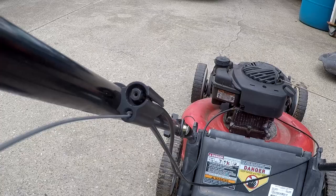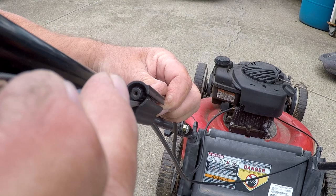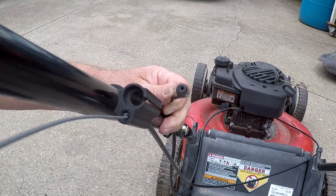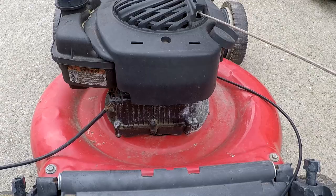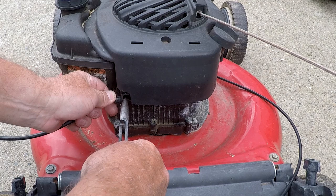Go ahead and remove it from the bar right here. Come in here with a screwdriver like so — you can see these little tabs on here. Just grab the end of the cable, pull on it, and take a screwdriver and push that tab up while you're pulling on the cable. Then go up here to the top, push it, and it should slide right out. Now come down here — as you can see this is busted as well. Turn this around to where you can get a hold of it with some needle nose pliers, squeeze these two tabs on the end, and it should come right out.